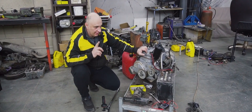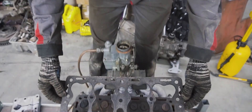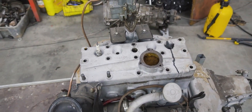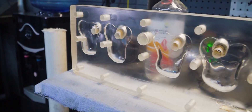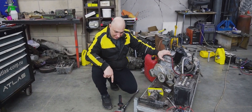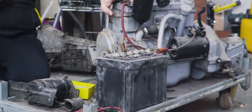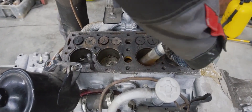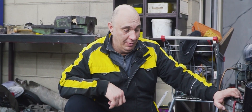In order to do this properly, the engine has been sitting cracked open without the cylinder head for a little while. We've decided to temporarily assemble it with the old iron head, start it, and let it run — so that an oil film forms on the cylinders and gets the compression up. Once we're done with that, we remove the iron head, install the transparent one, and run the engine with the see-through head. We'll be using a drill as a starter, since the old-style battery we have only provides 6 volts — not enough capacity for a regular starter motor — but enough to power the ignition.